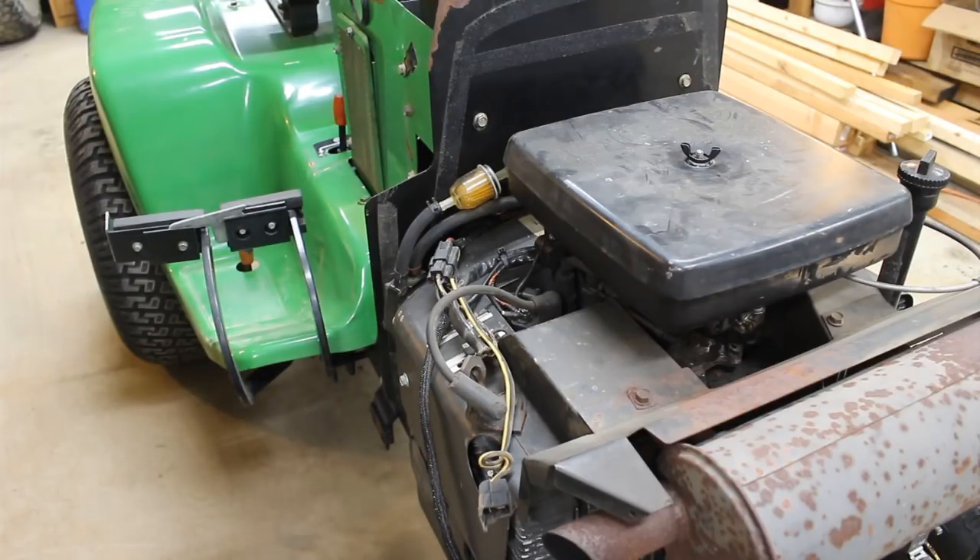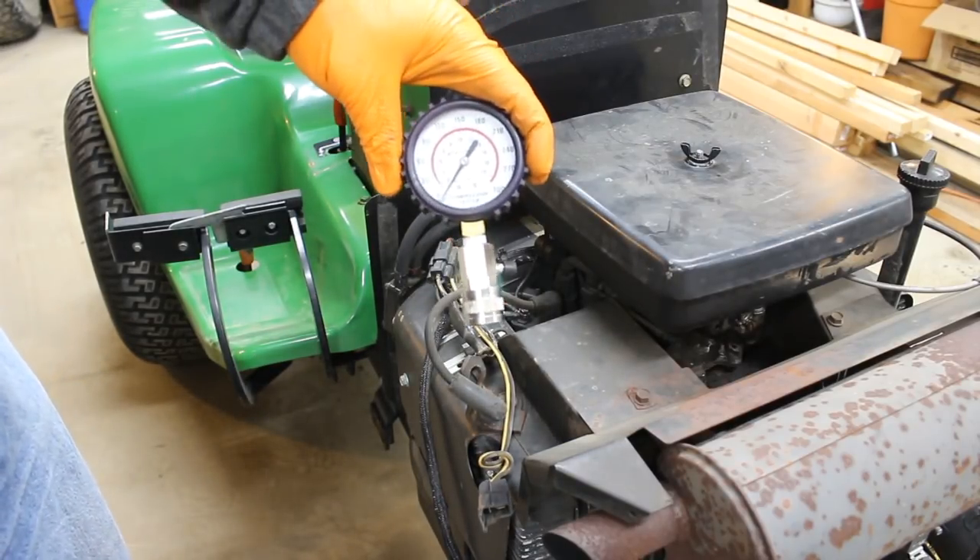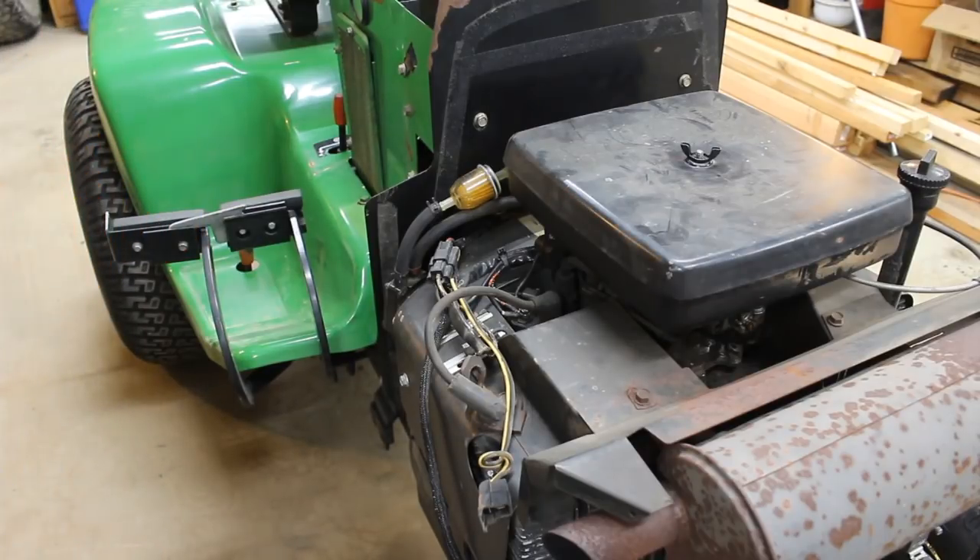So that's how you test the compression on these Onans or any engine. In fact, I recently bought a diesel compression gauge — probably in the upcoming couple weeks, maybe mid-January before I get around to it. On this gauge it only goes up to 300 PSI, and the diesel is going to have higher compression than 300, so you'd blow the needle right off this gauge. We're going to test the compression on the Gator in a future video, hopefully by mid-January. I also need some parts from Deere for the injection system — that'll be coming up. Some of my issues with the Gator will be in the next couple videos. Thanks for watching.